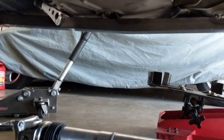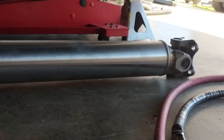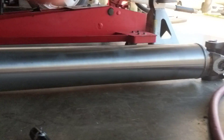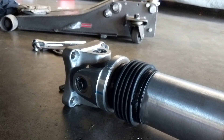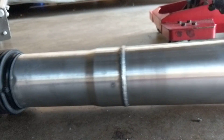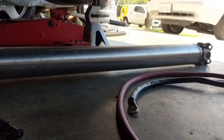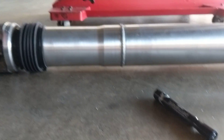As you can see I'm under the car - excuse that annoying train making a guest appearance. Here's the driveline. I'm in Stockton but I got it made in the Bay Area. This guy gave me a hell of a deal on it - 1350 U-joints, stock 8.8 flange, 1350. I told him the exact length I needed, he made it same day, no deposit. I paid for it when it was ready - I believe it was 550 bucks. You can't even get an aluminum driveline for a stock S197 six-cylinder car for that much. Aluminum driveline, lifetime warranty, free balancing for as long as I own it.